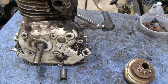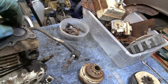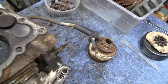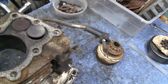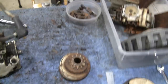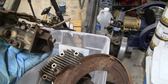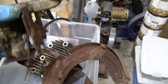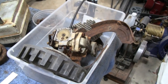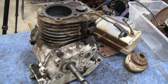So I guess we've got to tear this thing all the way down anyway — that's where we're at. Between now and the next video it'll give me a chance to clean this up, get all the grease off, and assess it. The valves look good — the guides in there are tight, no rocking or anything. We'll soak everything in Kroil and loosen it up, wait for the carburetor rebuild kit. I think we might get it running. See you in the next one.